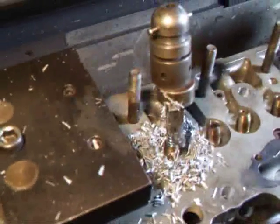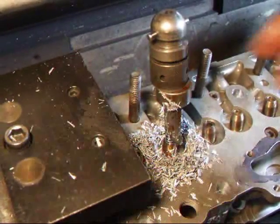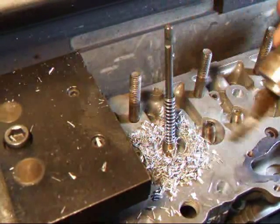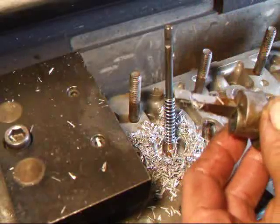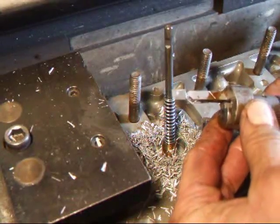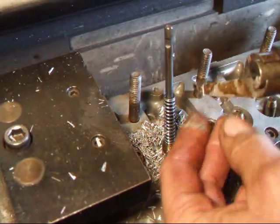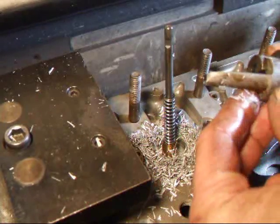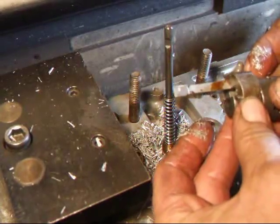I think there we have it. This tool bit that I'm using is something that I made specifically for doing this type of job on this type of engine. We have to cut out the spring pockets for heavier springs, longer springs, because we want a lot more lift out of some of these engines. Sometimes you have to make your own tools, and this is the case for this one here.